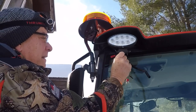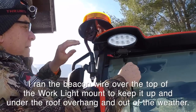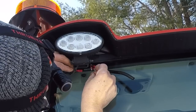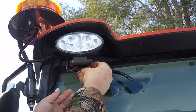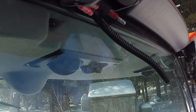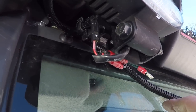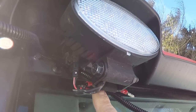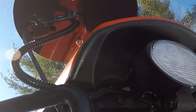Okay, that's good. Let's put that back where it belongs. We should be able to connect it in — black and red here. I was able to slide those bullets up underneath the LED and behind. I've got the green one out right now because I might want to use it to set the flash pattern, unless I like the first one that comes along. I'm going to cut this loom off here just so that this stuff can sit back in there. I wish I had more of a drip loop there, but that'll do. We're looking pretty neat — I just have to put that back up, cable tie it, then start up the tractor and see what she looks like.